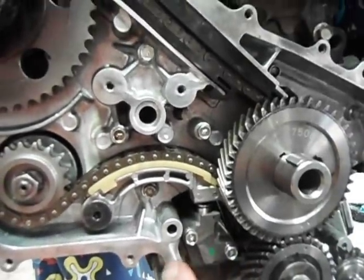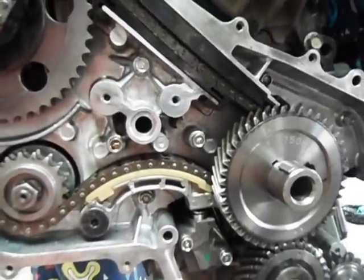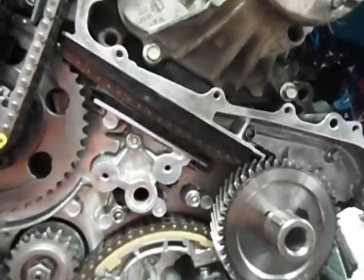So the timing on the balance shafts is right. Everything else is good to go — good clearance everywhere. The chain looks like it's not rubbing; this has been a duplex chain and it has clearance on the cover everywhere, so it shouldn't be a drama. All right, I think I can just about spin it over now — very good.